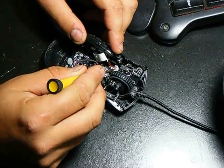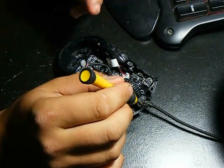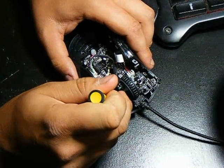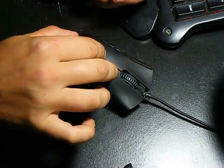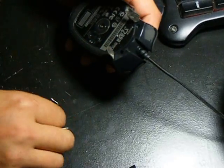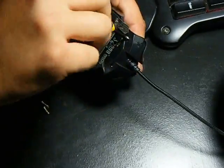Make sure all the wires are intact. Make sure that the plugs are pushed down properly. And the micro switch on the inside really shouldn't be worn down. I used this mouse maybe like three months playing World of Warcraft, so I don't know why the switches are so sensitive. But now just reassemble your mouse — just put the top right back on it, give it a good press, seal it back up, flip over your mouse, and re-insert your screws. Just snug them in. You don't have to tighten them down until you get all four in, or else the case won't close evenly.